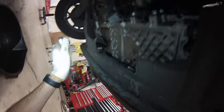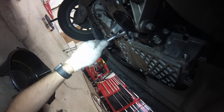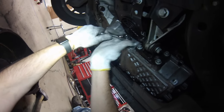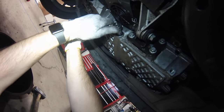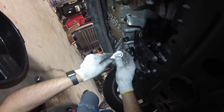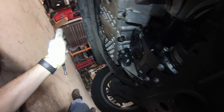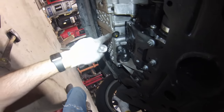First I'll get under here and drain the oil because we've got oil and water mixed together. If you're just replacing the head gasket for another reason you might not need to do it. This is a 13mm plug and I recommend using a six-point socket because it rounds off pretty easily and a lot of people over-tighten them. This one's being stubborn — it looks like it's rounded off already, so I'm going to need to go buy a drain plug as well. I'm going to go get my easy-out tool to get this off.